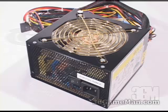This particular product has a wattage of 450, which is more than enough power for today's computer systems. Now, how is this wattage determined? Well, to understand that, you need to know what rails are. Rails are basically well-regulated transformers which convert domestic current into voltages that your computer system can use. And there are essentially two different rails, the 3.3/5 volt rail and the 12 volt rail. In this particular case, the maximum output of the 3.3/5 volt rail is 190 watts, and the 12 volt is approximately 264 watts. Which is essentially how the wattage of this power supply is determined.